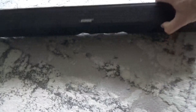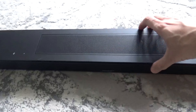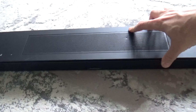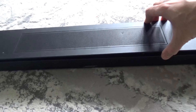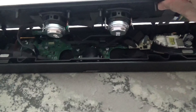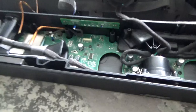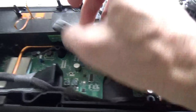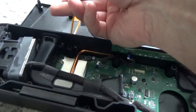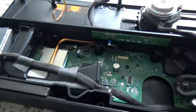I'll open the screws from the bottom — all the screws need to be removed from the bottom, and two screws underneath the rubber pads as well. Once those are out, the lid will disconnect and if you lift it, it will just come off. There will be two ribbons on the side: one ribbon connected at the bottom, and this one is the ribbon for the buttons, right over there inside.